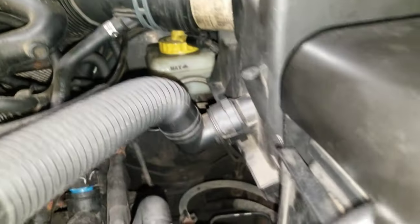Before my test drive I checked the fluid level to make sure it was good, added a little bit, and was good to go. The first few shifts felt great, and then I got a little aggressive and made it grind. I figured out what it was — and this lines up with things I saw on VW Vortex. If I push the clutch in and try to shift really fast I'm more likely to get a grind, but if I push the clutch in, give it a few seconds, and then shift — it's buttery. That leads me to think it's one of the hydraulic components, so I'm going to start with the clutch slave cylinder. I know I've got good fluid, the system is bled, and the bushings and shift feel are great. I'll get the slave cylinder in over the next couple of days.